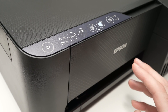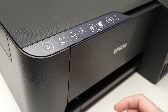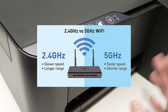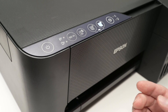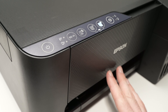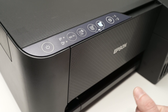Finally, make sure your printer is connected to the 2.4 gigahertz channel of your Wi-Fi router. Many routers have both a 5 gigahertz and a 2.4 gigahertz channel — sometimes with different names, sometimes the same name. This printer works much better on the 2.4 gigahertz network, so adjust accordingly if this was the issue.